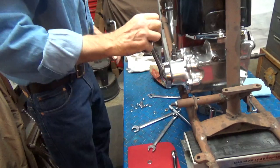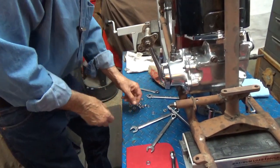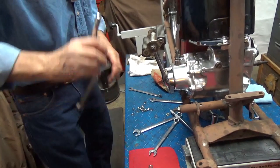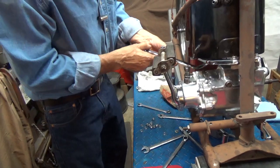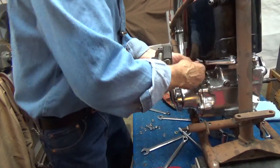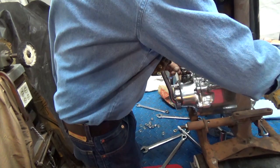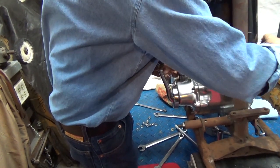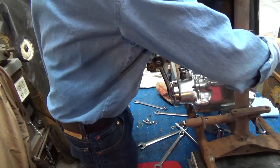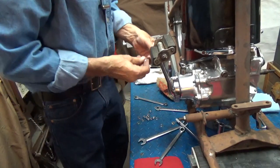It looks like we hung it up somehow — we'll take it off and find out why. Having a little problem here. I don't have a half-inch wrench, so you'll have to excuse me while I get one. I probably got that pin on the kicker gear hung up somewhere and we're going to find out where. I don't see anything wrong. Unless somehow I just had it wound up with the throwout bearing. Now we'll try it again — put that push rod in the shaft. Now that looks proper. We'll get this one over here and give it a try. All right, two of them is good enough for our purpose — we're not turning an engine over. But there it is, and it's working.